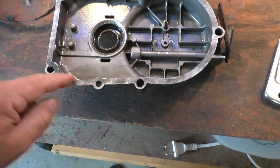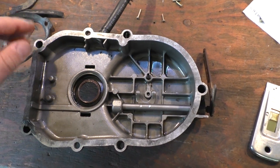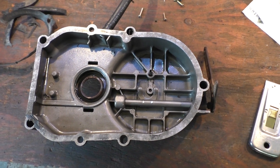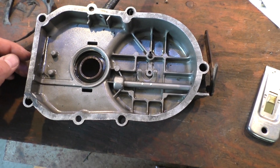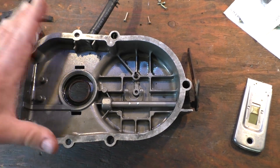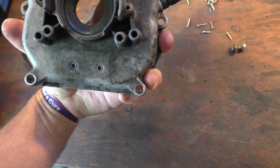I'm going to use some RTV silicone sealer in a very, very small amount, then lay my gasket on there, and do the same on the mating surface on the engine — super super thin, just something that's going to squeeze out and give a nice seal. Then we'll get this tightened up. The torque on this timing cover was, I'm going to say, 10 foot-pounds for these bolts.